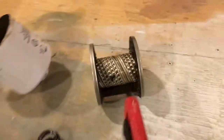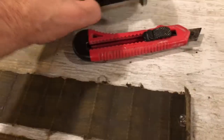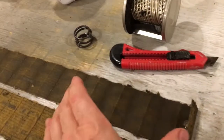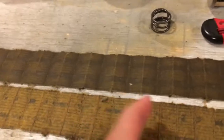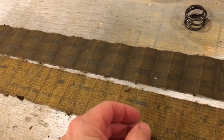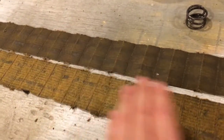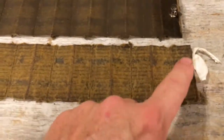You cut open the oil filter, pull out the guts, and then using a knife you cut all the way down the sides to cut the fabric away — the whole thing is quite messy. Then you take the fabric in its accordion shape, cut it in half, and put it in a vise using a lot of paper towel or rags. You squeeze it to get all the oil out, then stretch it out on the table using a couple of pins to inspect it.